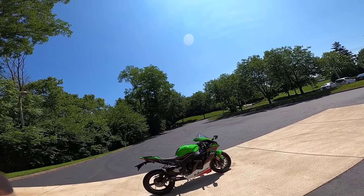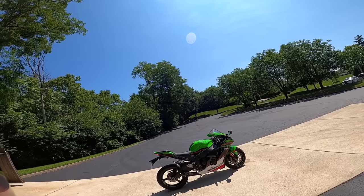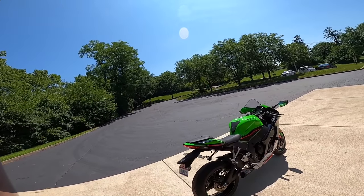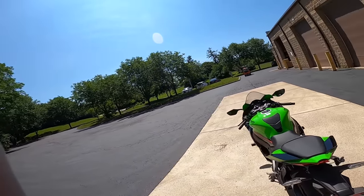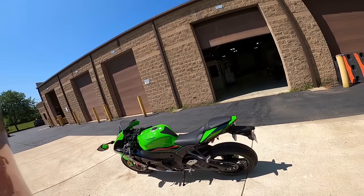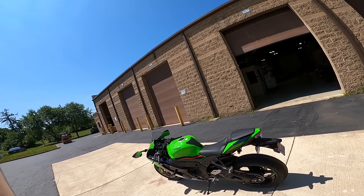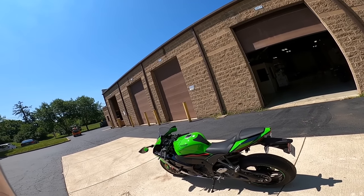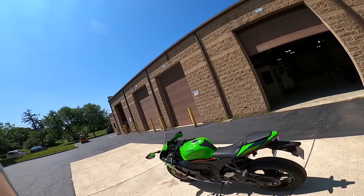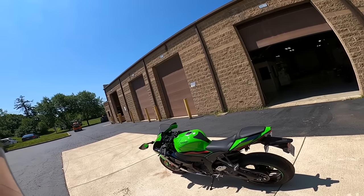And probably the biggest, single largest improvement is the BT Moto. This is the second stage flash. And I put a map selector switch for the Power Commander. So right now it's on map 1, which I've got set to pump gas. And map 2, if we decided to put MR12 in it, this thing made 214 horsepower all day long with MR12. Didn't matter what the weather was, super consistent.